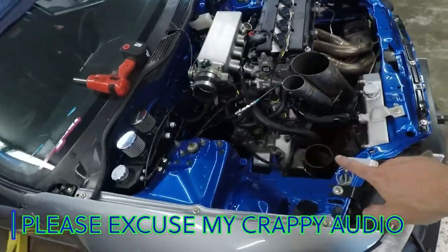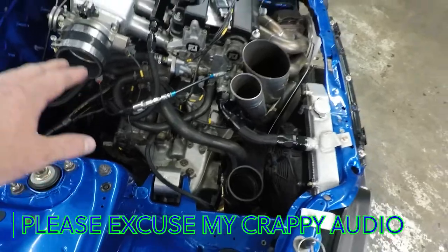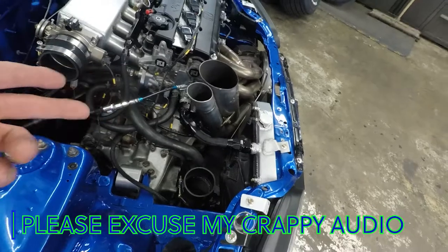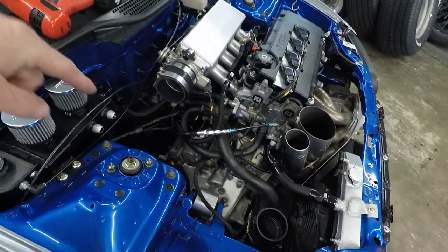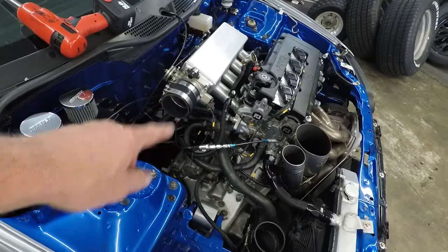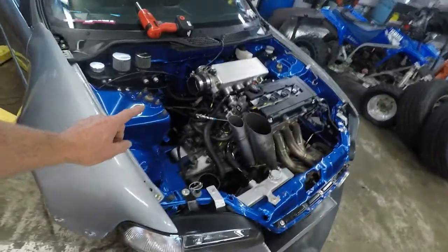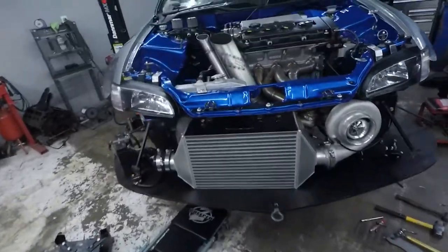Taking the charge piping off so it doesn't get in the way, basically going to the starter mount. The motor has a mid plate connected to the tranny, so I'll get it up in the air, pull the mid plate off, do the shift linkage and a couple motor bolts, the rear T-bracket for the trans. The axle is already out of it so I just have to slide it back and drop it on the floor, but I need to get Jamie a measurement on the axle first.